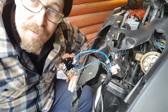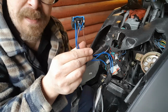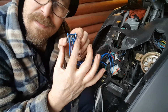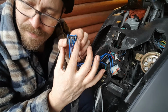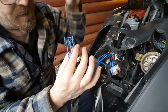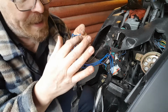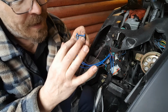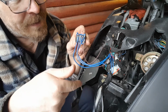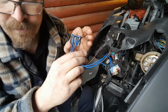Okay guys, I've been busy doing some stuff. I needed one more relay actually. So now we have two relays. I'm gonna do a test run here and see if it works. The first relay is the auto stay latching relay. When ignition is on and you have pressed the right handlebar, the right brake switch, it will latch and stay latched until you turn off ignition. The other relay will latch also, letting the low beam go through when the first one has latched first.